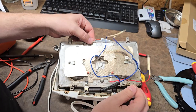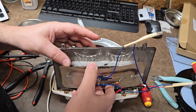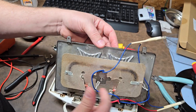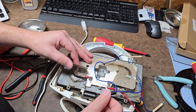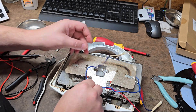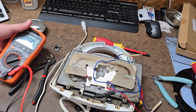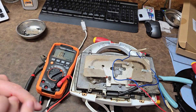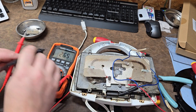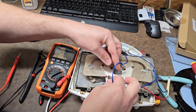Let's see what else we've got. The heating element is kind of molded in around the base there. While we're at it, let's go ahead and measure my heating element. I have one of my leads disconnected - 26.3 ohms. Looks pretty good. None of these wires are arced or anything. I'll go ahead and put them back on.